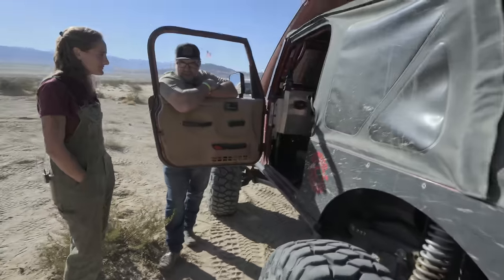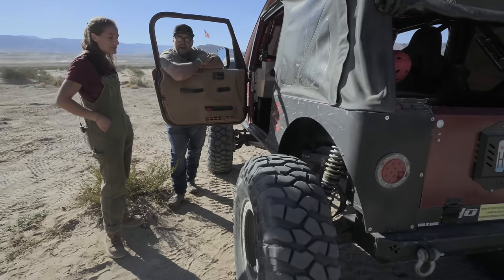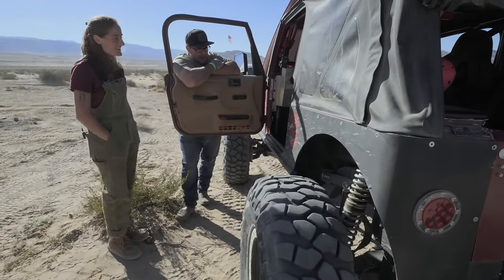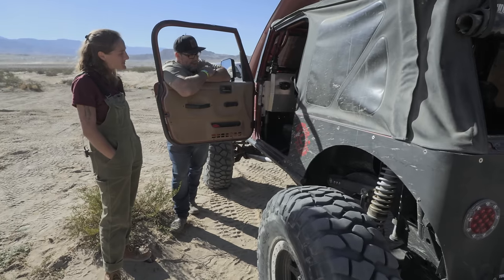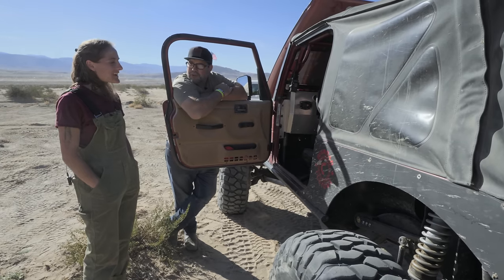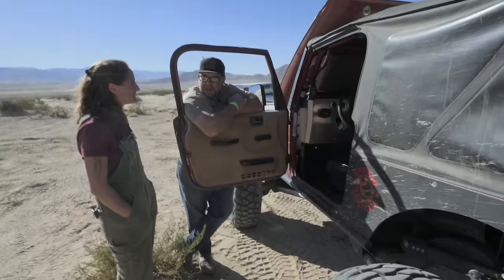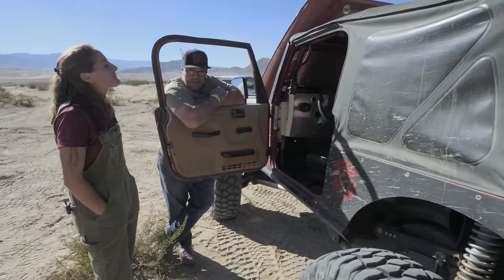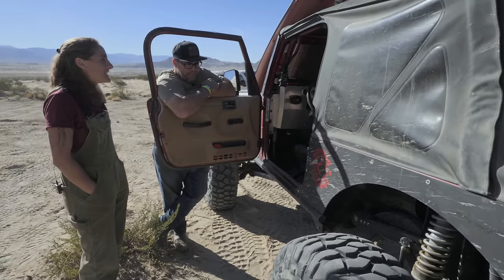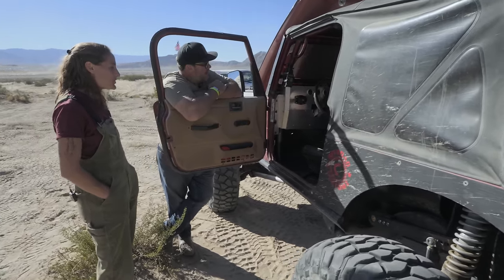I noticed you have the 450 shafts in the front with the big U-joints, and the rear axle shaft stock in the Sterling. Still haven't broken one, right? Don't look too close, but this spindle's bent a little bit — it still works, so I haven't taken it out. Full floater — I'm not going to take it out when I don't know if it'll go back in. All my Yukon gears are warrantied lifetime anyway, so I'm going to run it while it runs. Full hydro — you can't really drive it around on the road comfortably, but do you drive it? Yeah, I get up to 50, 55, 60 max. I'll cruise around St. George, around Moab. Do you wish you would have put a box in it? I miss the drivability, but I do not regret going full hydro. You're not going to have issues now — it'll go 55. We're going to Rubicon, Fordyce — that'll be plenty to get me from the end of the trail back to my truck and trailer.